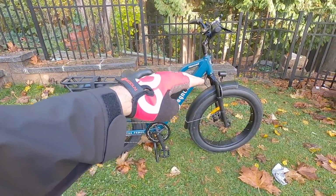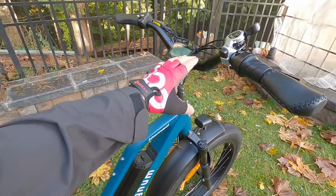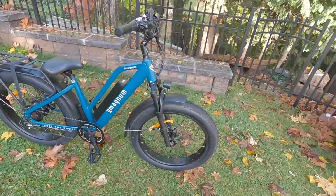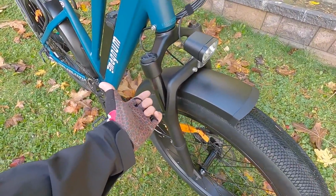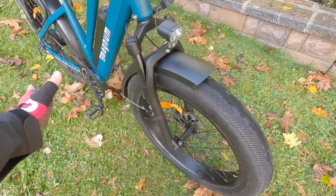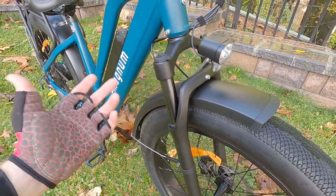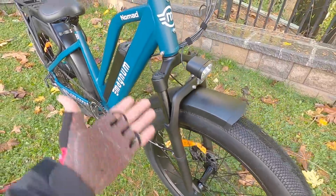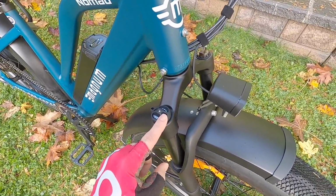And imagine those handlebars are twisted back a little bit. Since they're mid-rise, they could come back closer to you and you could lower that stem. Lots of possibilities here. Even the suspension fork, this is a little bit above average. I think it's steel. I used my magnet on this. It's not an air fork. It's not super lightweight. We've got 100 millimeters technically of travel right there. I think it's probably more like 80 millimeters in practice. You know, decent. And then a clicker here for compression adjust that goes all the way to lockout.